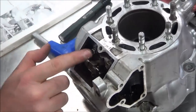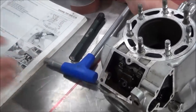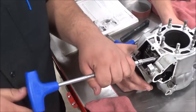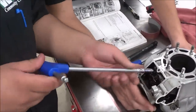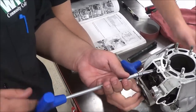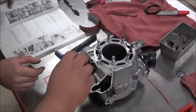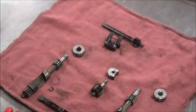As much as possible we're not prying on anything. I think these two screws have got to come out because I think they prevent the whole body from coming out. Let's see - remove and unscrew the two main exhaust screws. They're already cracked loose. There's a washer in there that basically just hits that valve to stop it from pulling out. Where else have you seen a bolt and washer set up holding something in place? On the crank cases - bearing retainers. So I think this is retaining that power valve assembly from coming out. Let's try and pull the whole assembly out.